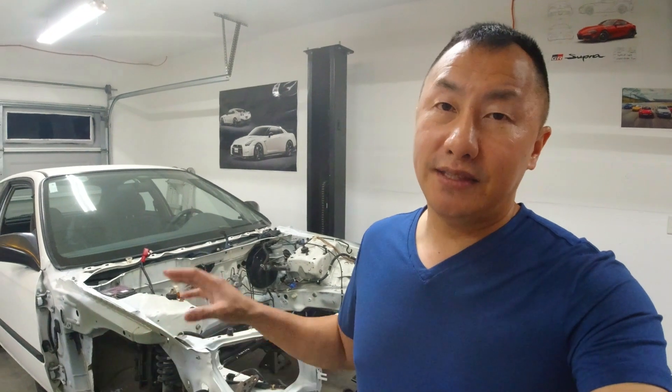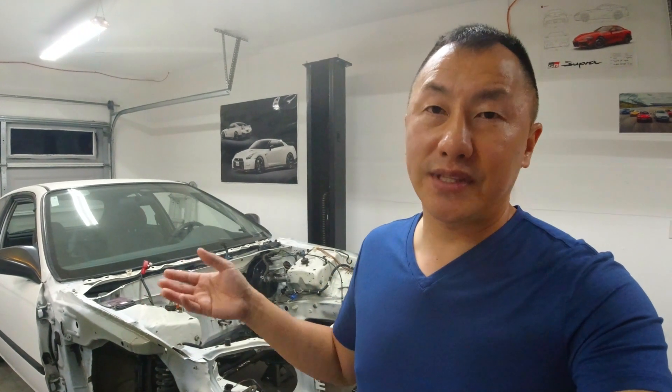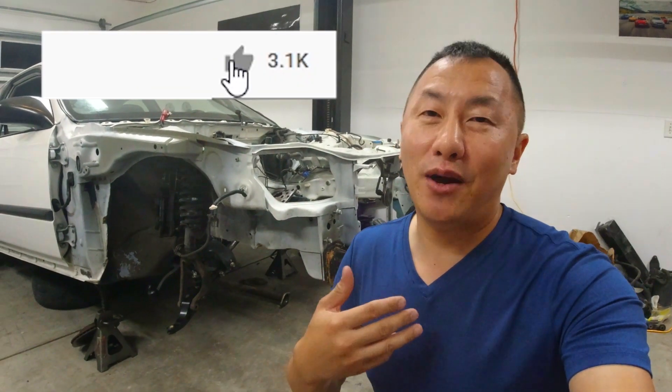That's going to be it for this video, guys. I was thinking about putting everything together and making one long video, but I think that would take away most of the details that go into this swap. Every K swap has its own unique issues or features, and I want you guys to see what I run into. You guys saw the removal of the D-Series and the Civic's front subframe, the preparation for the Integra subframe with all the new bushings installed, depowering of the Integra steering rack, and also the installation of the Integra subframe into the Civic. You can use a 92 to 95 Honda Civic front subframe, but the problem with that is you won't get the quicker steering ratio of the Integra's rack and pinion — that's why I got the Integra front subframe. For the next part I will be working on the front knuckle, so make sure you hit that subscribe button for future content, and don't forget to hit the like button to help with the YouTube algorithm.